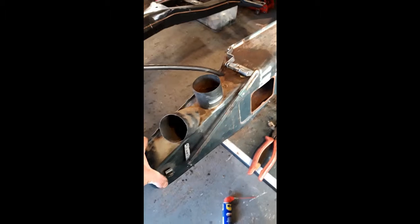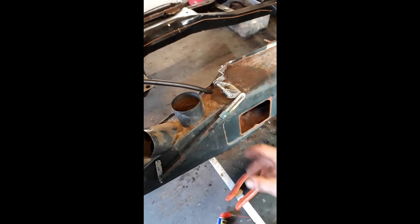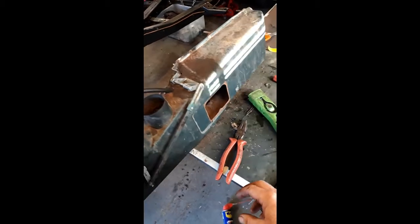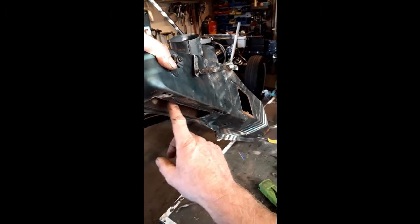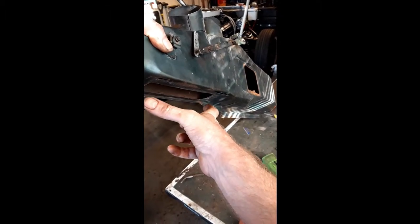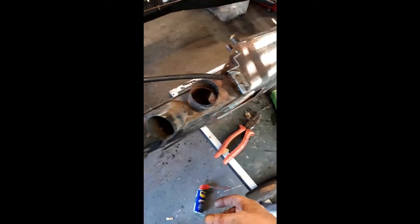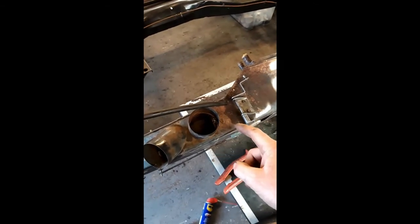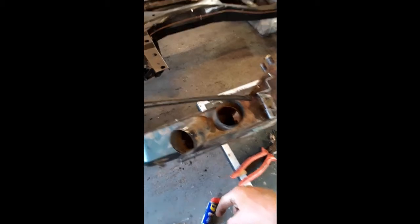And this side, this is inside the car, basically under the dash on the right hand side, which will be the passenger side in the yank tank. These vents go up to the windscreen. And underneath you will see a gap. That gap feeds down to the rear footwells. So that flap inside, when it opens, is allowing air, hot or cold, to be diverted down into the footwells.